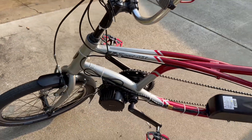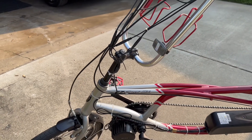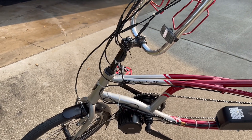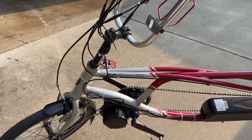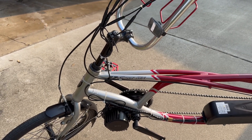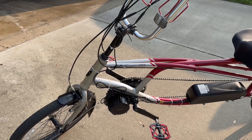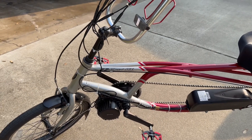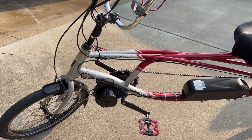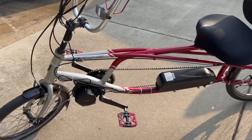Here's the one mistake I made — a happy accident, if you will. The OEM system that Bacchetta uses on their Pronto line is 250 watts and about 95 newton meters of torque. This unit is 1,000 watts and 160 newton meters of torque. That's literally four times the power of an OEM unit, so if you put it on the top assist level and start pedaling, the bike just takes off.